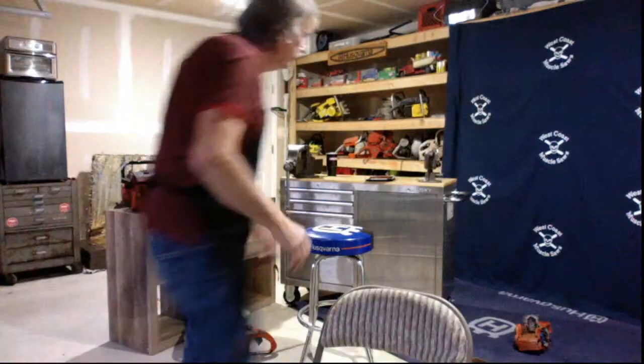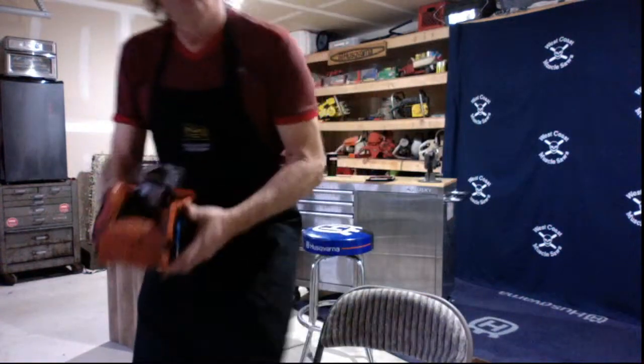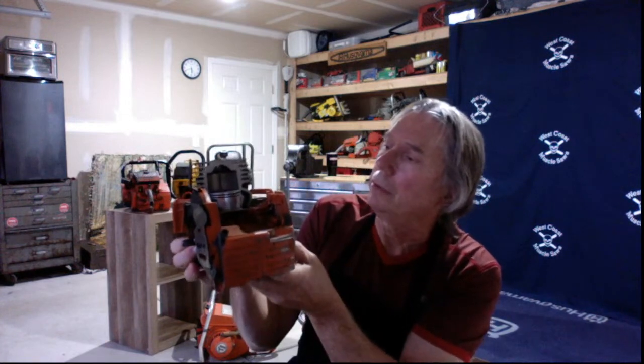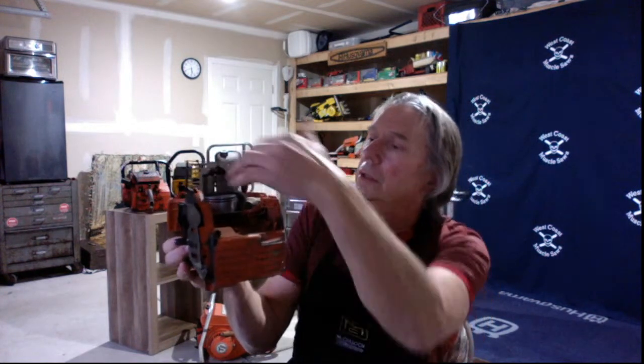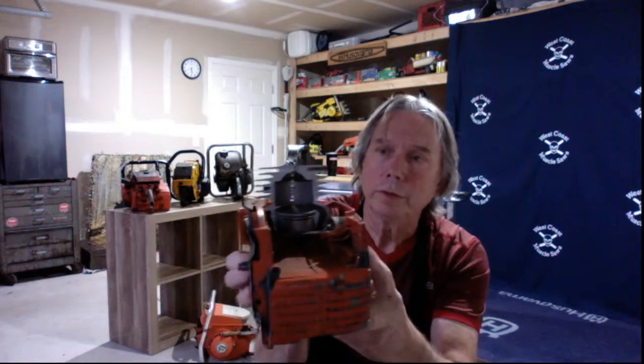You can flip the cylinder over and you can see the passage here, the way it works. Here's the other, right there. Got it split apart, and you can see rotation here as the piston goes down. Skirts, we're filling up the crankcase, pushing the mixture into the transfer port. You can see there, shoving it on top of the piston, and then we're going to compress it.